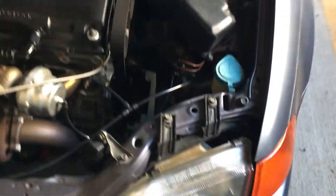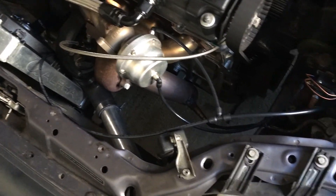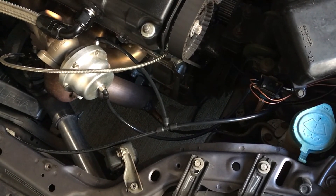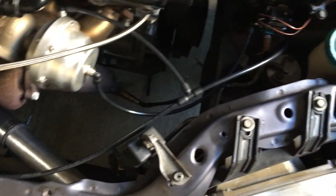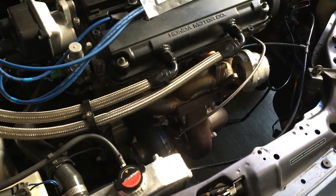So let me show you guys how it actually turns out. From the top of the turbo it splits — one line goes to the bottom of the turbo wastegate, and that goes to port number one on the solenoid. Then the top of the wastegate goes into port number two on the AEM solenoid. I'm just going to tie it up, make sure it looks good, and that's pretty much it guys — have a good one.